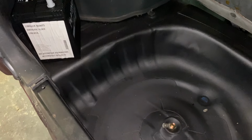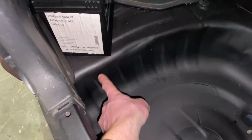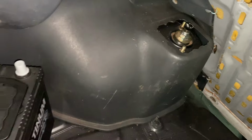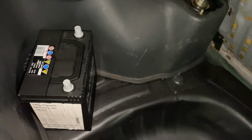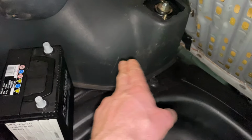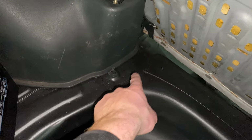We'd do it obviously as tidy as possible, that we'd route it and maybe tie it off against the wall here, and then it's a straight shot up and bang. So what do we need to do then is find the home for where the fuse is going to go. It's recommended to put the fuse I think 30 centimeters away from the positive pole, so somewhere around here, maybe up against that little bit of inner plastic there.